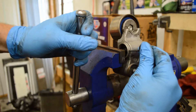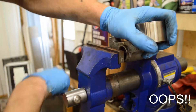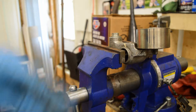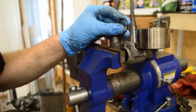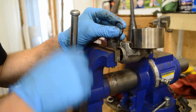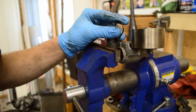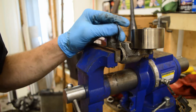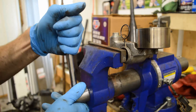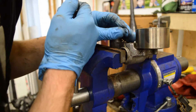We're going to stick the pin into the outside hole — make sure your direction is correct. As you can see, I have my hole right here and I'm going to stick it in and wait for the piston to come in, slowly and gently, just allowing the pressure to equalize. We don't want to ram it in too much because we can risk blowing out a piston — I have had it happen before, so take my word for it.